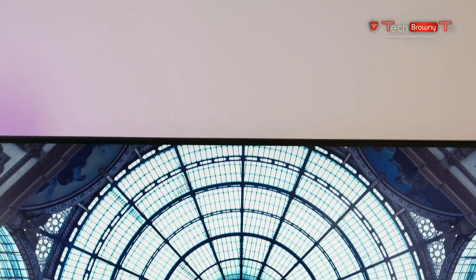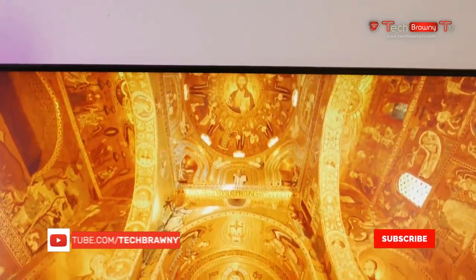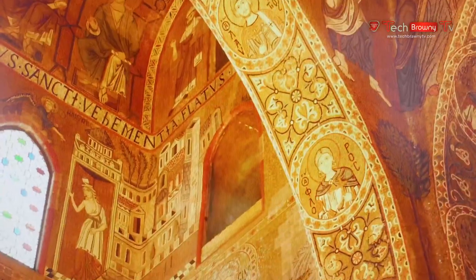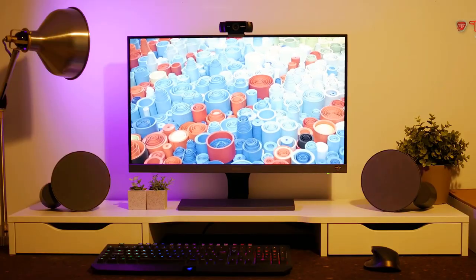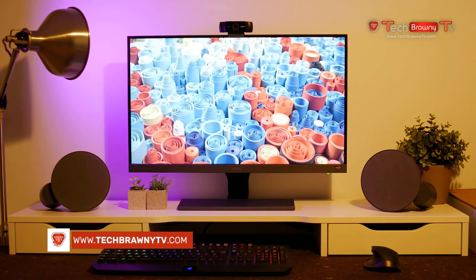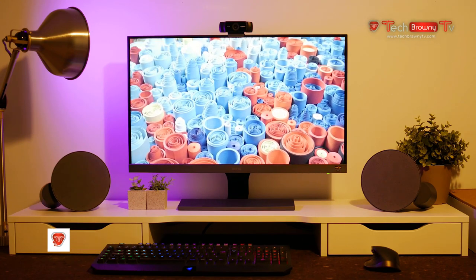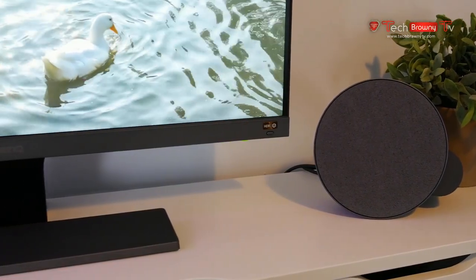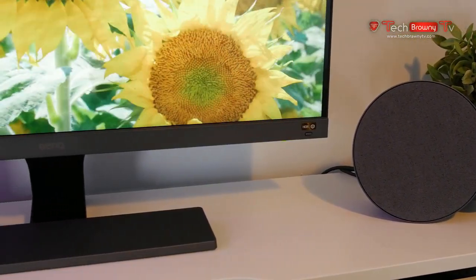My PC right here, for example, can't play HDR natively with the current graphics card. So you need a 7 series or newer Intel CPU, or you need an Nvidia 10 series or newer GPU. I have neither of those because I'm on AMD, and that's a big issue for me personally trying to use HDR. So I swapped in the 1070 Ti to try HDR.